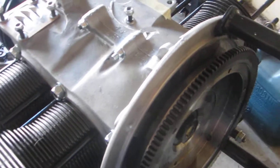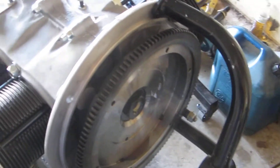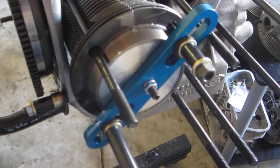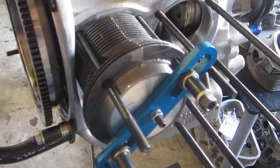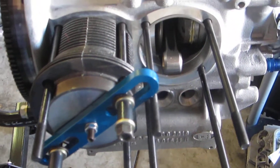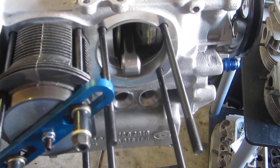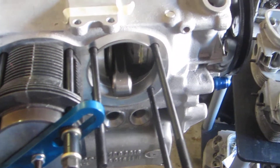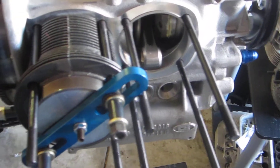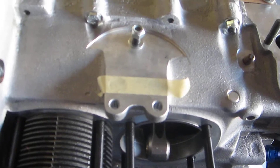In the back of this engine is a lightened 12 and a half pound chromoly flywheel. Coming around, we have number three — this is where I was working last night mocking up the deck height on that. I'm using my little V8 deck bridge that Comp Cams sells, and that seems to work pretty good. Inside this engine there's the 84mm stroke counter-weighted crank — CB super crank — and five and a half inch H-beam rods, an Engle FK46 cam, and on top we're going to be running a doghouse setup hopefully.